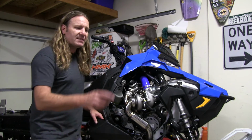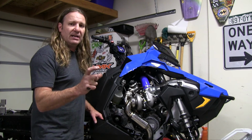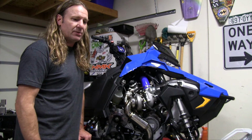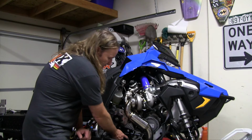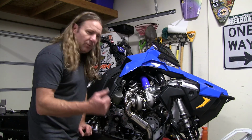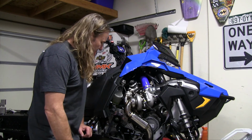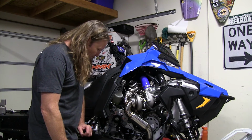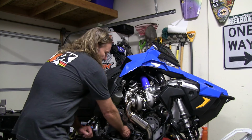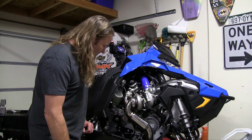In our tools list, we talked about using an Allen wrench, and I showed a bent one. You're going to need a straight one for clearance, and also when you're torquing that bracket down to 25 pounds. Don't forget, you want to heat the cast, not the bolts, when you're removing those original T40 star bolts. Also, we needed a 9/16 socket to torque down and tighten the tensioner to the bracket.